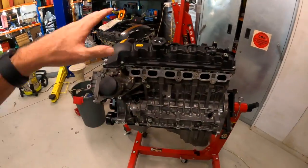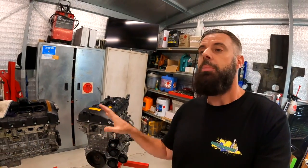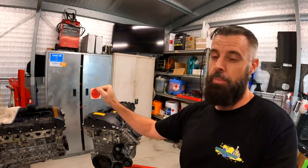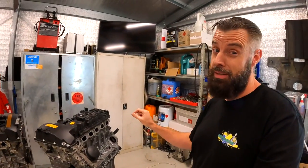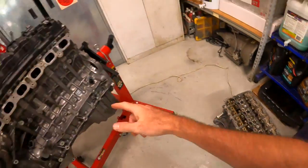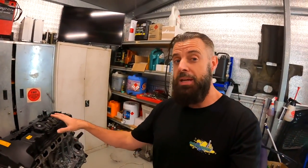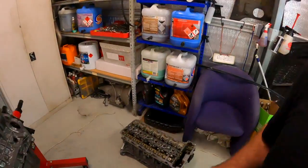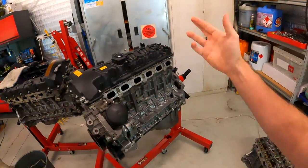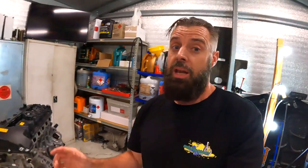So it's done some temperature changes and then I wanted to check the bolts again. I have re-torqued them. Five of them went a little bit further — not much — but they are now all over 145Nm and I got those torque readings without the cracking or the binding going on. At this point in time, I'm pretty damn happy with it. Also, when I was messing around yesterday, I went even further on the test bolt. I really wanted to make sure I'm not going to be damaging or pulling the threads in this one. Hopefully you saw the video where I tapped the 11mm threads to 12mm. But yeah, there's some crazy stuff going on — some cheap head bolt upgrades that, if this works, could be a good option for people on the budget build side of things. That bolt is now torqued to 189Nm and it hasn't pulled the threads. It's kind of crazy.